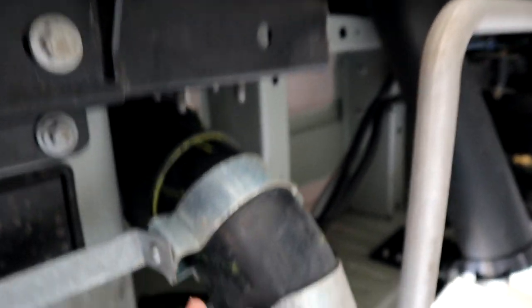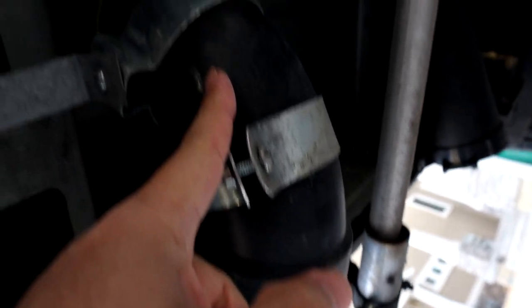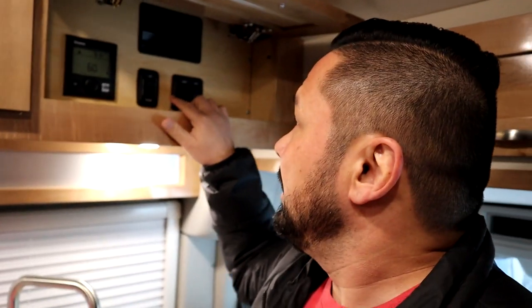The gray tank and its pipe and valve are exposed on the van. Down underneath, here's my black tank valve — there's an elbow that goes up into the van above the spare tire where the black tank is actually inside the van, but that elbow and dump valve are exposed. A lot of people have a false sense of security with tank heaters because you still have those exposed elbows that can freeze.